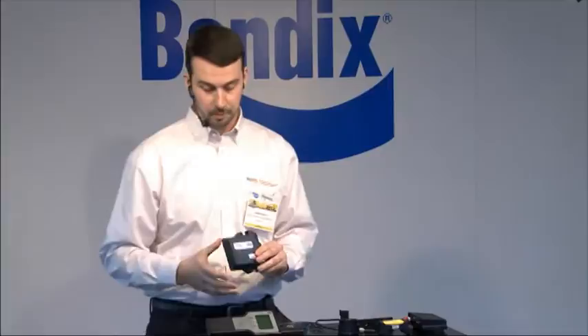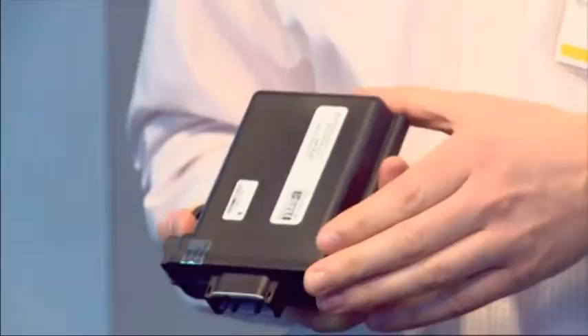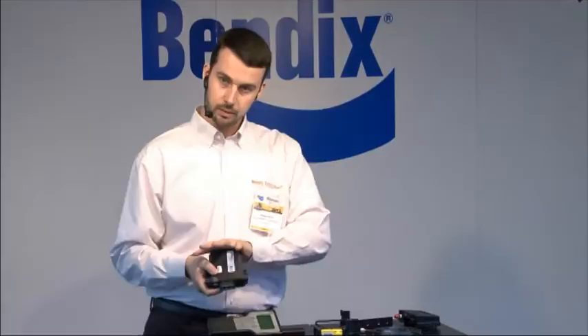Newly introduced this upcoming month in April, we're actually bringing out our TPMS trailer unit. It works very much the same way as the vehicle-mounted version, but with an even simpler install. It's a simple box that gets powered off an ABS power splice at the back of the trailer. You would just install this between the rear trailer axles. The sensors and strap methodology from the tow vehicle is the same on the trailer — the strap wraps around the lowest part of the rim and the sensor gets threaded onto the strap to hold it in place. Once the tire is aired up, it measures pressure and temperature. The convenient thing is that as the driver hooks up to a trailer, he doesn't have to change anything in his standard routine — he hooks up his airlines and drives off.